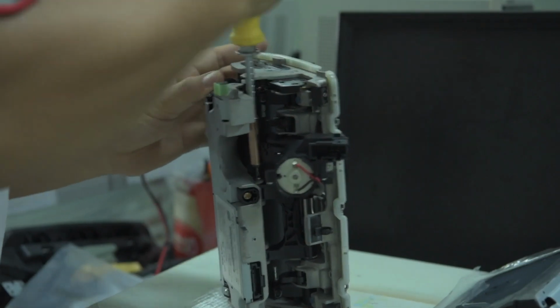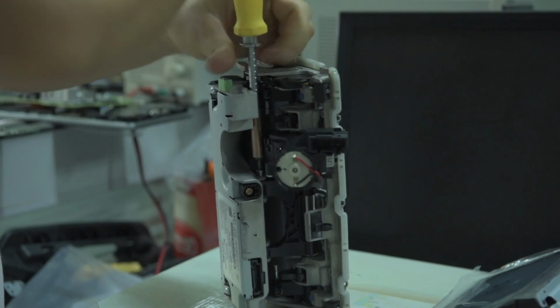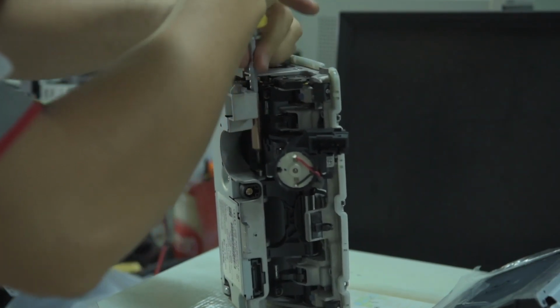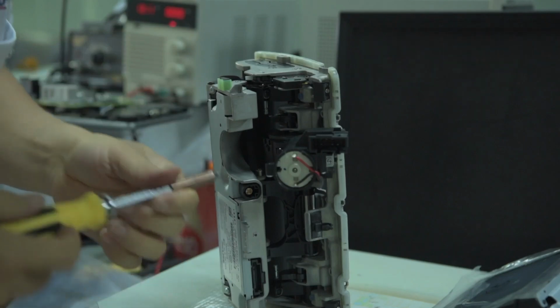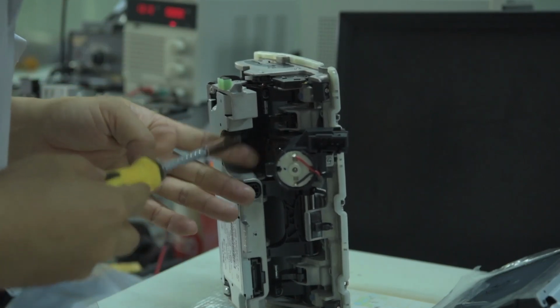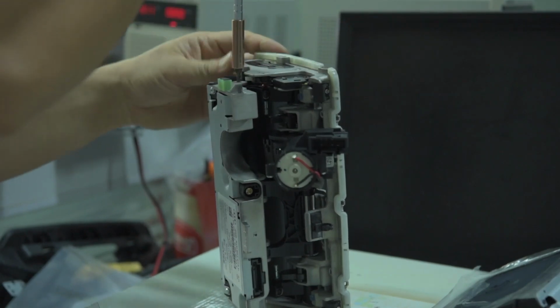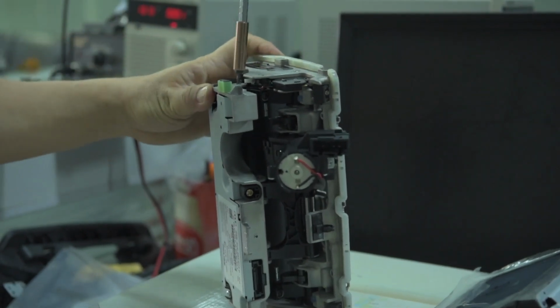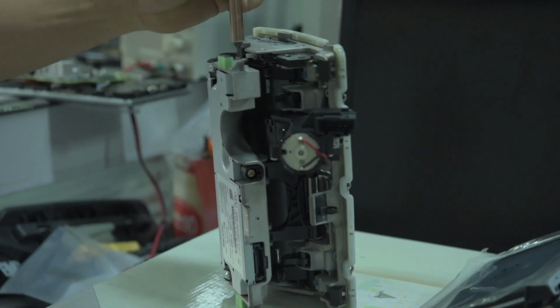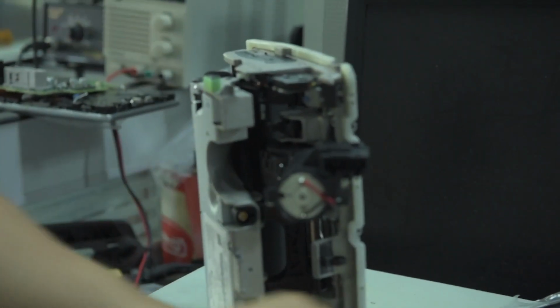If you want to avoid this procedure, what you can do is if you have VCDS, go to the infotainment system module and move the screen onto diagnostics position. So if you put the screen onto diagnostic position, the screen will move like that. But we are just here to show you. You can do this way as well. So we are removing screws.